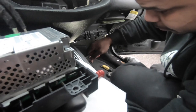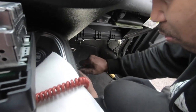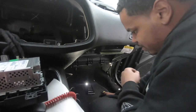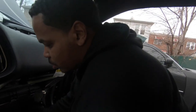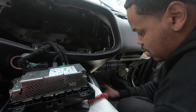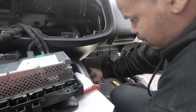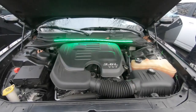We ran into a little trouble — we couldn't find the ACC on this car. Jay, we ended up going to the cigarette lighter. If you have a Dodge Challenger — this is a 2016 Dodge Challenger SXT — pretty much all Dodges are like this. The ACC isn't even wired to the radio. I usually cut right into the lighter, but these cars are sealed well, a lot of plastic and extra stuff. Being an older generation, we didn't have to do all this, but this is a learning experience — you learn as you go. We finally got it, and once we get everything running we're going to show you that light show.